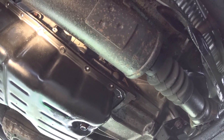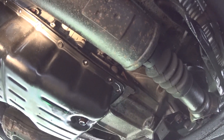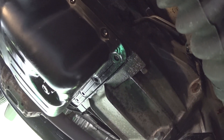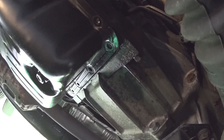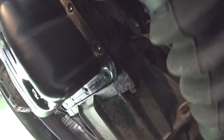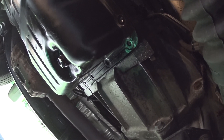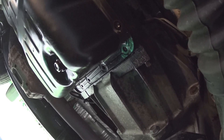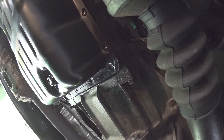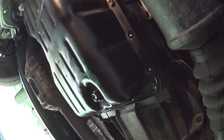I'm going to show you on a picture the difference between a corroded bolt on the outside versus an uncorroded one from the inside. Before you put them back together, apply a small amount of anti-seize or lubricant. Also note: the back of the transmission pan was wet because three or four bolts in the back were not torqued completely — that's why it was seeping. When you're putting the bolts back together, make sure you torque to proper specs. Don't over-torque — these are small bolts, you can snap them, strip them. Stick to factory specs.